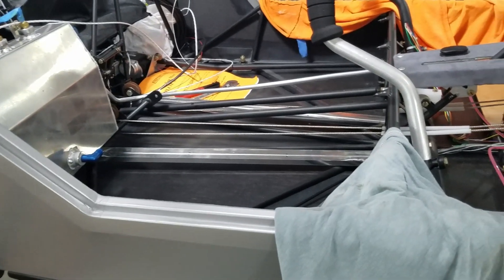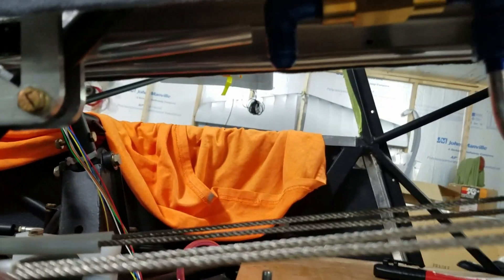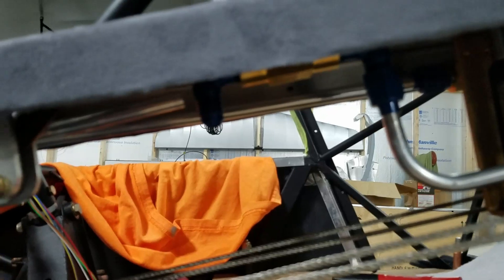A few lines are in. Just going to do some tying them together and tying them down where they go in. I have to put some wire stripping stuff on there, but she's all plumbed up. I've got to put a straight fitting on there instead of a 90. Everything else has ran all the way to the firewall and out the front. I'll get that fitting and get it finished up, put some tape on here where everything touches. I'm going to brace these together — braced here, braced back here, and tied together.